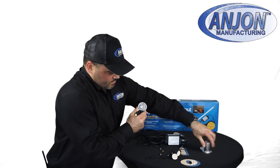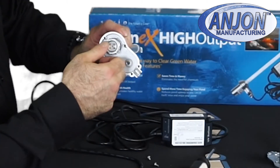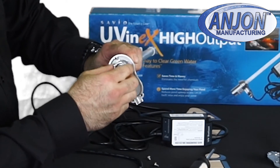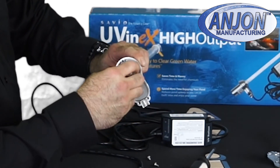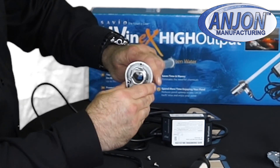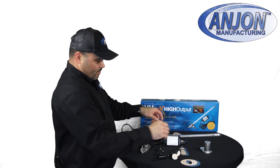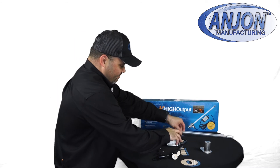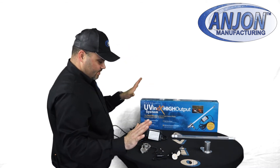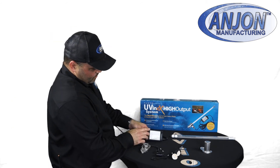So what we can do is set this off to the side and keep everything over here. You have your plug, and you have a friction washer here, so you don't have to take all that all the way out — this is enough so you can remove your bulb. If we were in a situation where this needed to be reset, the procedure would be to leave everything unplugged just like it is for three to five minutes, and that status indicator will reset.